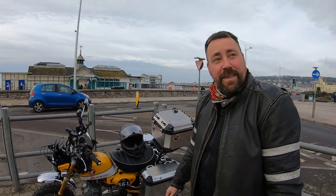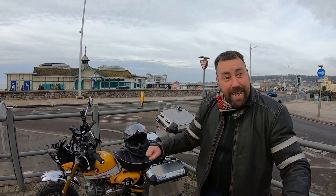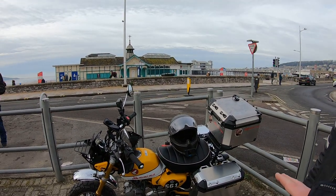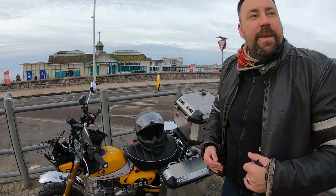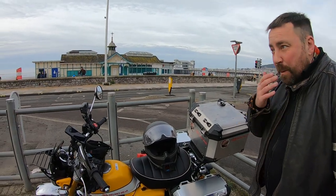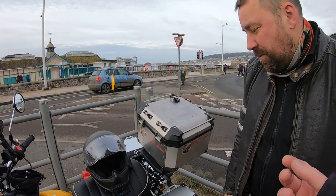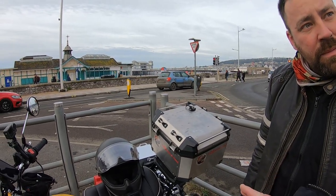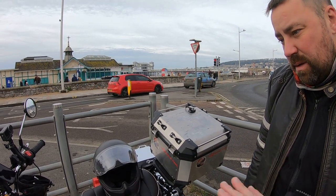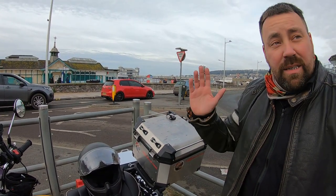GS of monkey bikes. Right, yeah, I can go with that. It literally glides. When you're going down the road, you don't feel bumps now. It doesn't do this. Obviously, I've set it up to carry a bit of weight. I anticipated what you were going to carry. But you can adjust. I've got the dampening on soft, and I've got the preload wound quite a bit. You're not even halfway. You can go loads more, but now it is perfect.